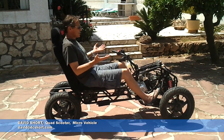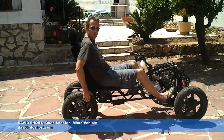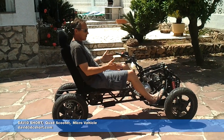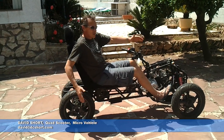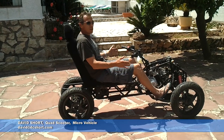Here we are in sunny Javier. This is a small four-wheel scooter that I've put together. Looks a bit like a wheelchair. It's to test the stability of a narrow, short vehicle. This is about 800mm wide and only about 2m long. So it's a bit smaller in length than an MP3, but a fraction wider.